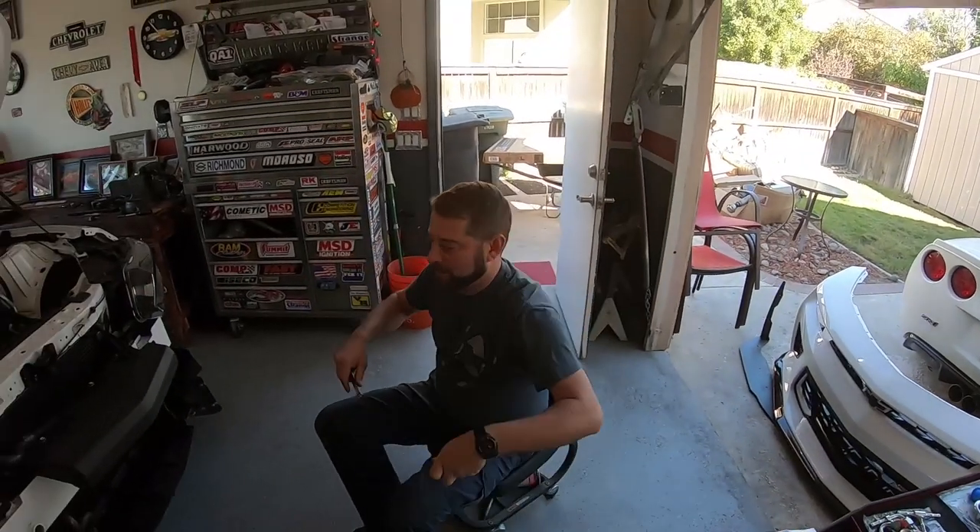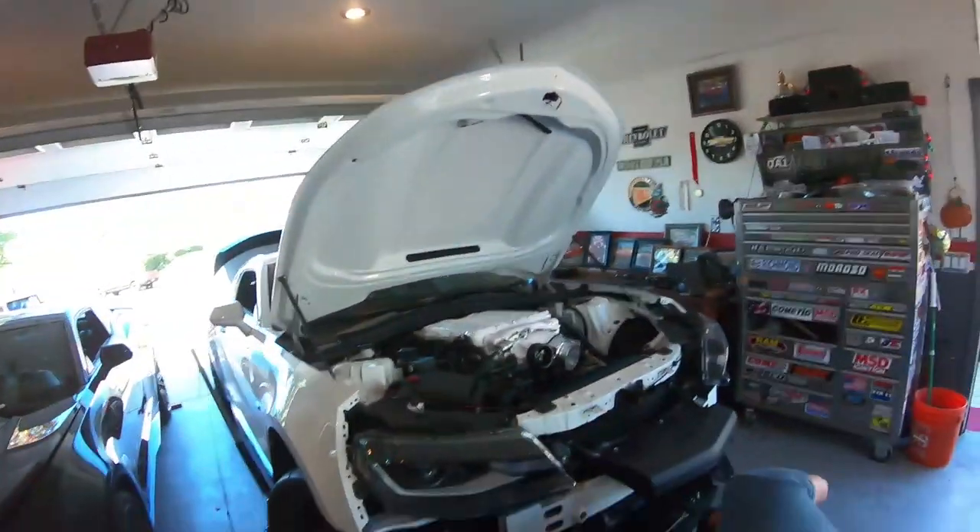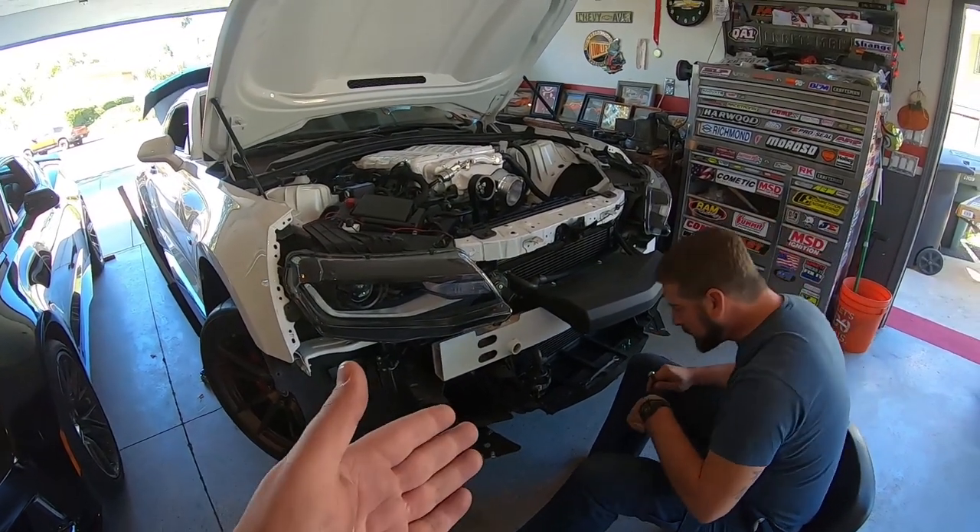One thing to highlight about this install: it requires you to recharge your air conditioner. The AC unit gets discharged and needs to be recharged - these use R134 refrigerant which is pretty easy to get. There are other vehicles using R1234yf - that's in the later 2016, 2017 and 2018 models. That stuff supposedly has a carbon footprint of one, but if it lights on fire it's terrible.